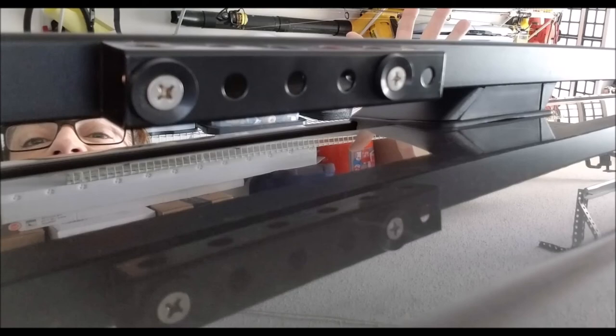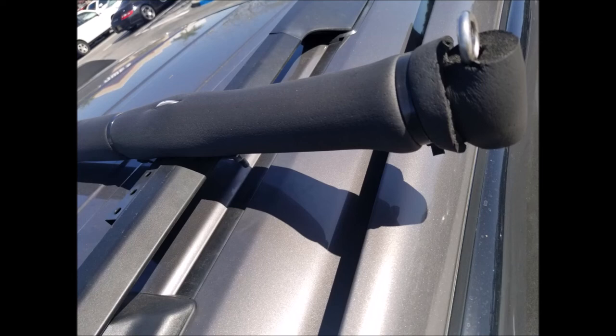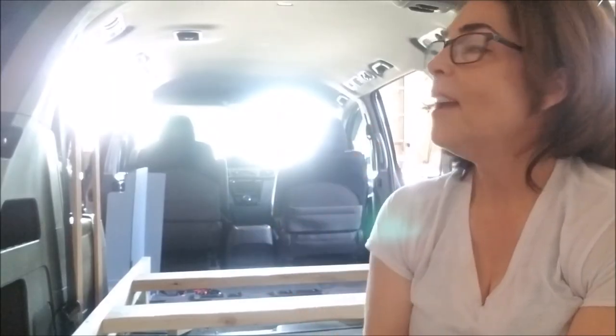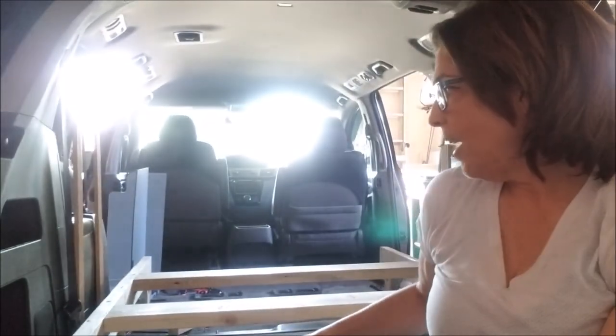So I installed the perforated tubing and added some accoutrements: eye hooks on the sides for lashing things down, bolted the whole thing with U-bolts. I even covered it with exterior pipe insulation — still an experiment, I have no idea how it'll hold up hauling kayaks, but it was only 15 bucks. It beefs out the whole look of the roof rack, which I love, and in theory provides some cushion so things don't bounce around. In the next video I'll talk about the interior build — thanks for stopping by!